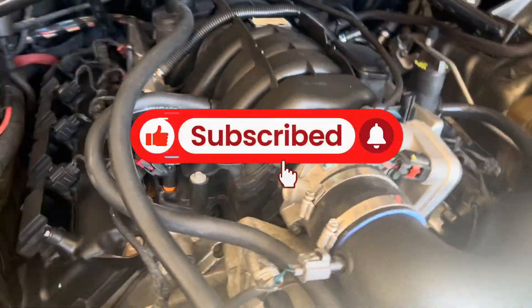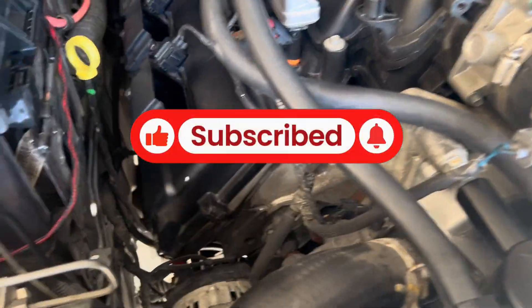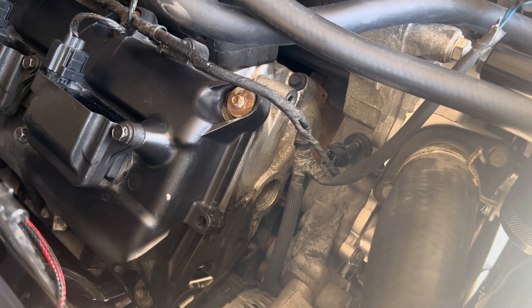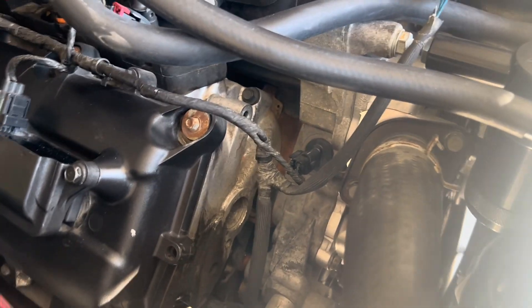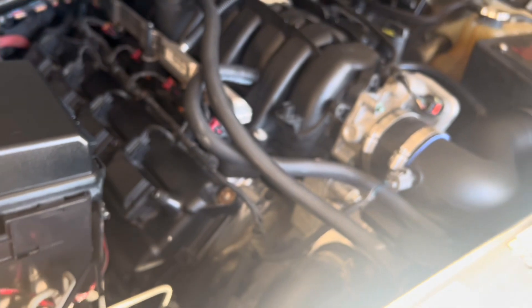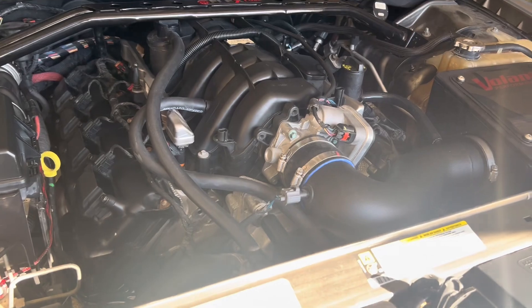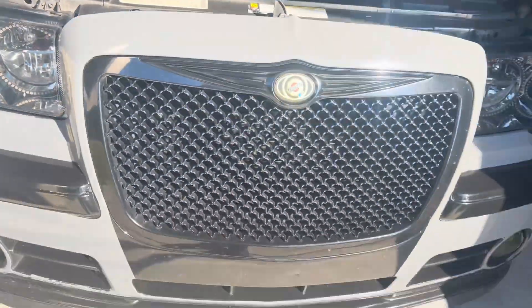What's up my people, so real quick mod for y'all today — we're about to do the 180 thermostat. First thing I'm about to do is get all this coolant drained, I got some fresh coolant to put in here, so I'm gonna go ahead and drain everything from the bottom of the radiator. I'm also gonna go into HP Tuners to show y'all how to actually change the fan settings, just in case you've never done this before.